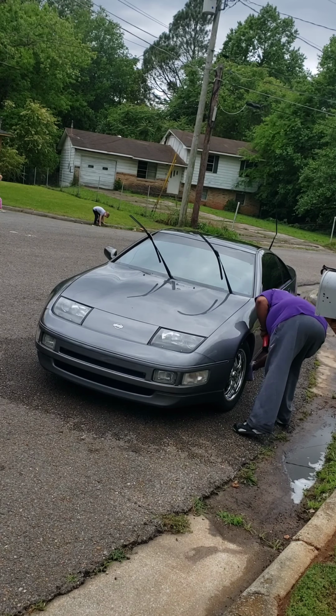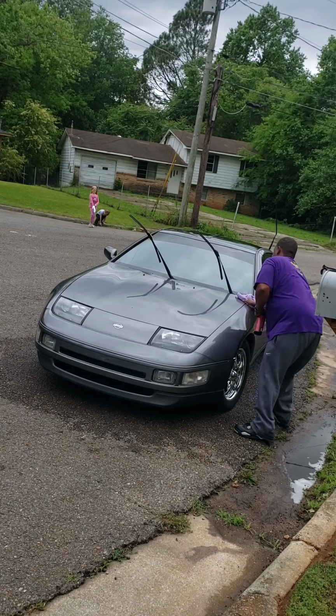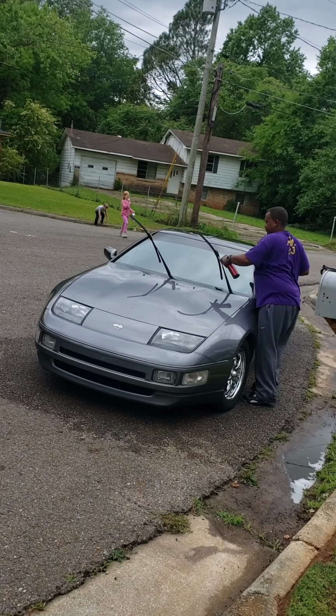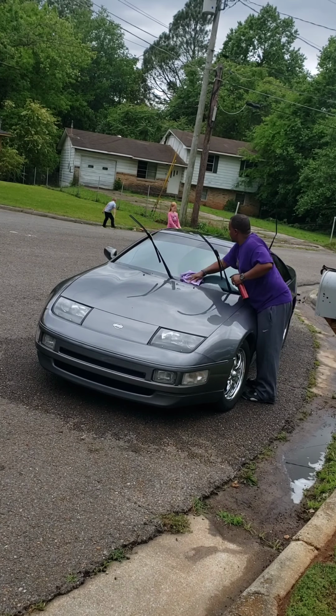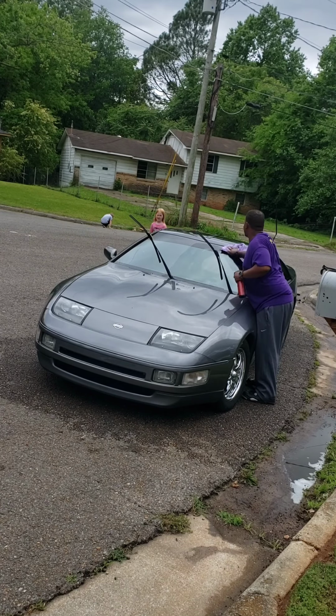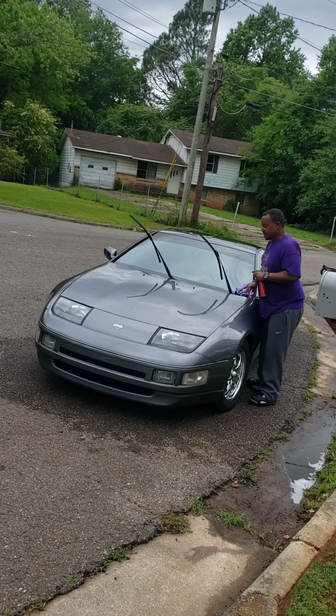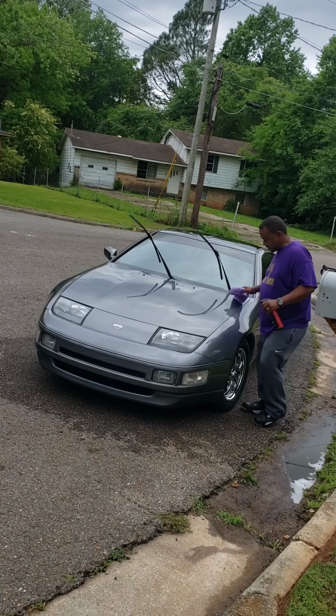I have found that if you do not mix it just right or you use alcohol that's too strong, it may leave a few streaks behind. But if you have one of these dedicated panel wipes, it leaves absolutely nothing. The stuff is just great. It contains alcohol, so you have to move quick. You see how fast it is flashing away now. But it will not leave anything on the surface.